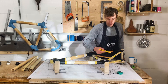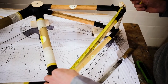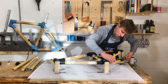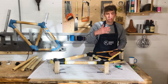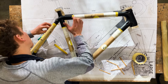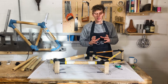The first step is to measure where the brake bridge is going to go. I'm going to take a tape measure, measure from the rear axle up, and make a mark at 365mm. If you're really unsure, you can fit the wheel and check the clearances. Then the brake bridge is going to slide in here.